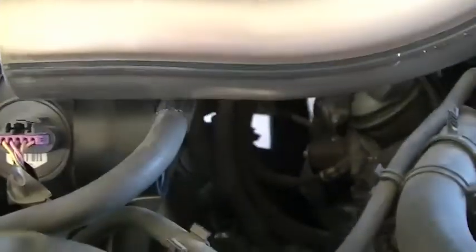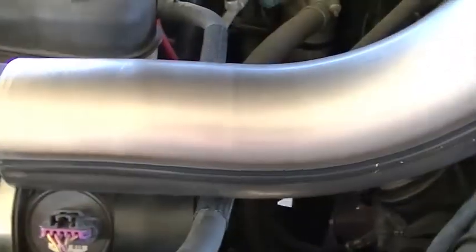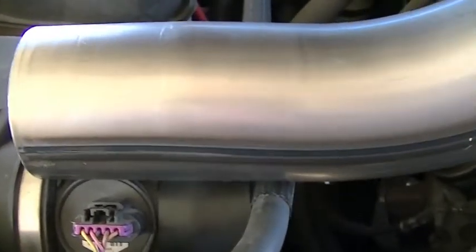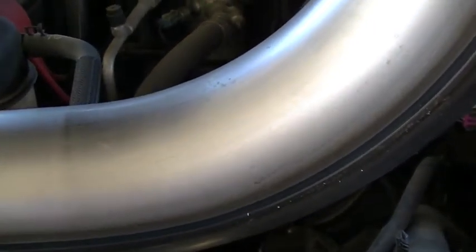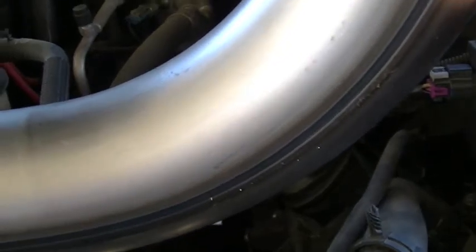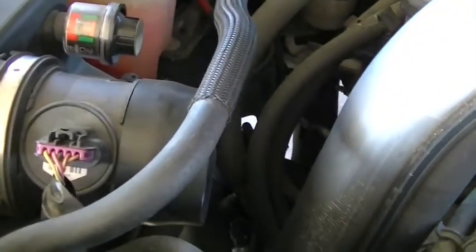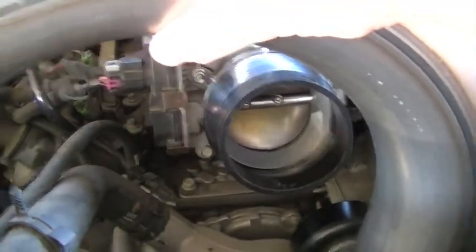I need to have a bend come up and over that upper radiator hose. What I'm probably going to do is cut off — it's looking like at least 5, maybe 6 inches of the leg of this U-bend to start with. And then I'll probably cut it somewhere in that area — not going 90 degrees up, probably 40 to 45 degrees over. And then I'll take another section of this, which will then be welded to the section coming off of the mass airflow sensor, up to there, and then on over to the throttle body.